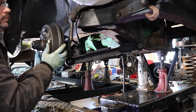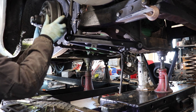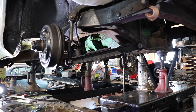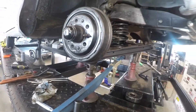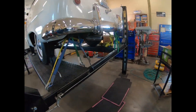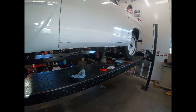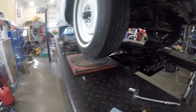On a car like this with all the link pins — all those threaded rods — there are so many chances of binding up, whether the caps are too tight or things are slightly out of alignment. Really make sure everything moves freely before you put the spring in. Putting the spring in on any car like this with limited space is difficult — use lots of jacks, straps, whatever it takes to safely and slowly put it into place. Lastly, do an alignment and road test the vehicle, and you should be back on the road.